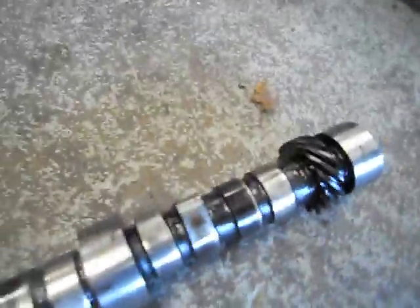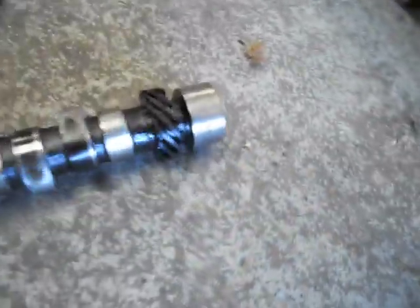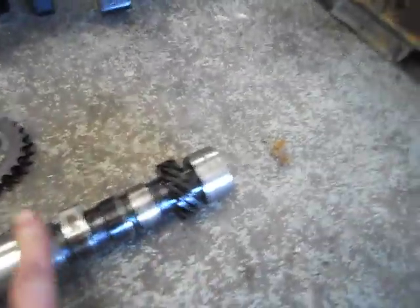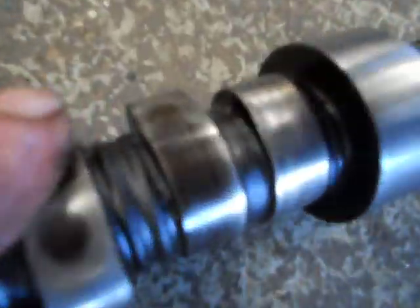See here the camshaft — as you can see here, if I slowly turn around, we've got a lobe there — look at that, that's just like a fuel pump lobe — that one, she's just totally gone. Now we've got a fair few run on here. We've got number eight inlet, we've got number seven exhaust — that's just non-existent, another one gone, just completely gone.